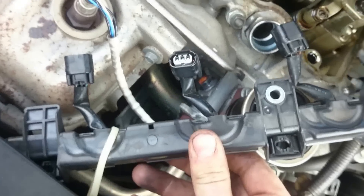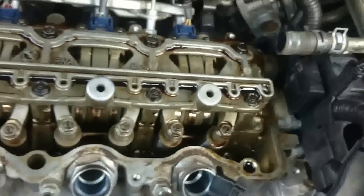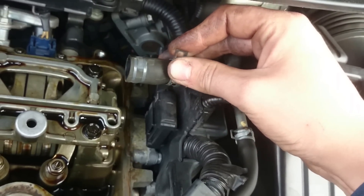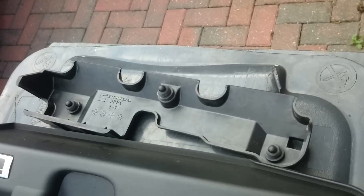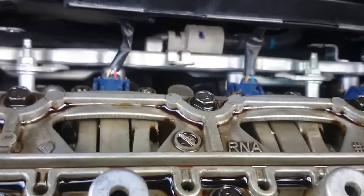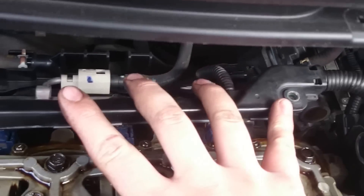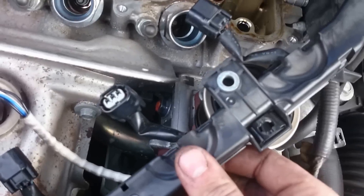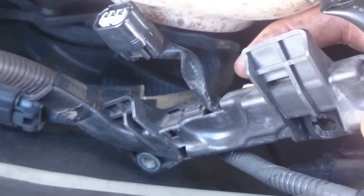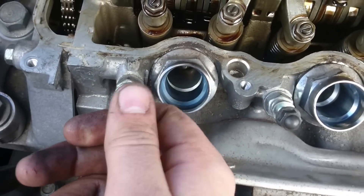The main things to disconnect are the electrical feed for the coil packs, which I've cable-tied down here just to keep out of the way. There's one clip here which is the breather pipe off the top of the rocker cover, and you need to pull out the dipstick. The rear cover has three little rubber grommets that pop into their holes and just pops on at the back. The front rail pulls forward and bolts onto the top of the rocker cover with two 10mm bolts. When I took my coil packs off I screwed the nuts back on — it stops things being sharp and you don't lose them.